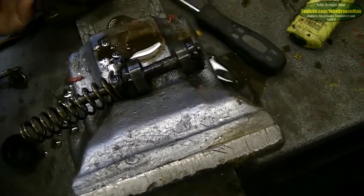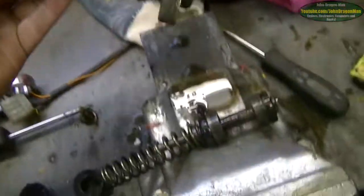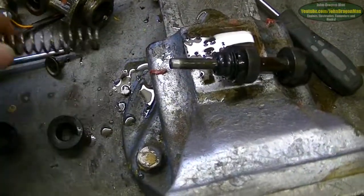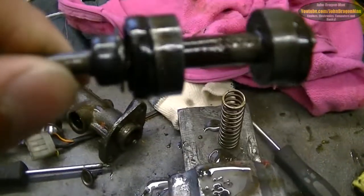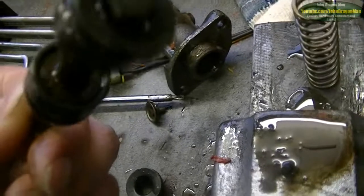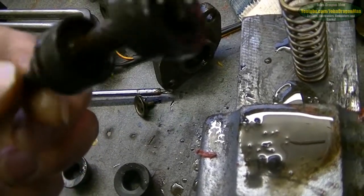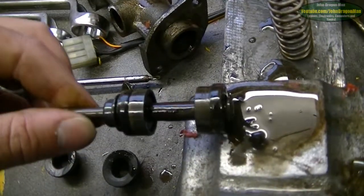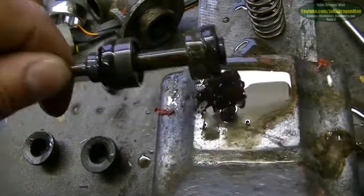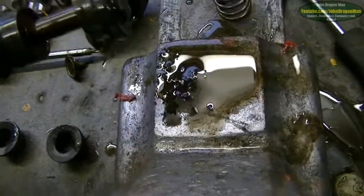With a bit of gentle persuasion — a hammer and a bendable welding rod — I managed to fit it down the gap there and hammer the old one out, the one for the back cylinder. Not really that much that goes into these things; it's quite a simple hydraulic system. See how I bent the clip a bit — whoops, good job I'm not using it again. You can see the crap that came out of it though. I reckon that was my knackered seal — look at it. There was so much crap in the thing — all of that came out of the rear master cylinder. Nasty.